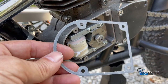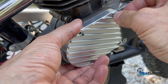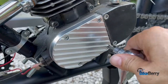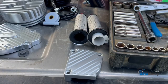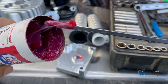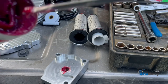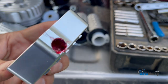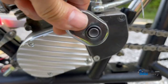Make sure your gasket is in good shape. When you go to put on your clutch arm cover, we like to use Lucas red and tacky grease — fill up that cavity. You can see I painted this one black just for fun too.